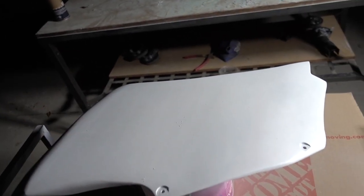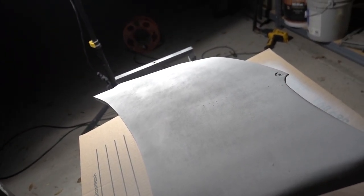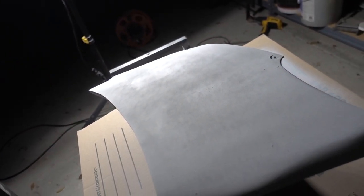So I got this front bumper cover all completely done. Well, not done, I mean, it's primered. As you guys can tell, it looks kind of textured. I'm thinking it's because of the cold. I don't think the heater is doing enough justice for me bringing it to the cold, then to the heater. So it might be causing these little texture-type things you guys can see right there. So I'm probably just gonna call it quits right now. Sand it in the morning, a light sand, and then I'll just repaint it again with a primer, the white primer.